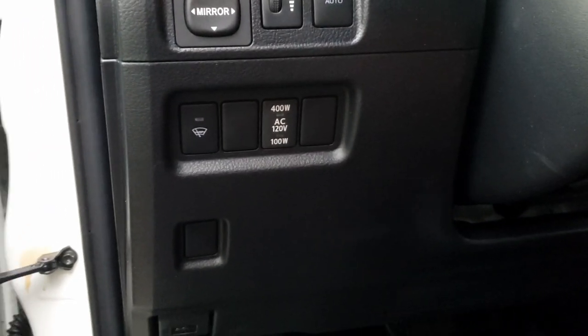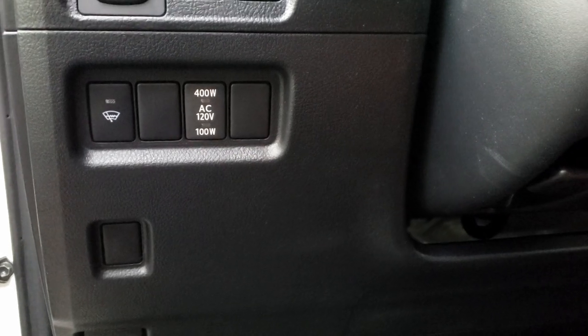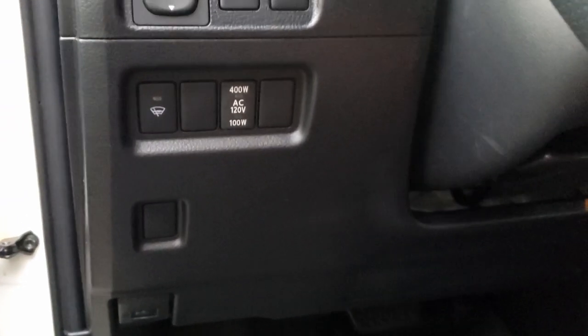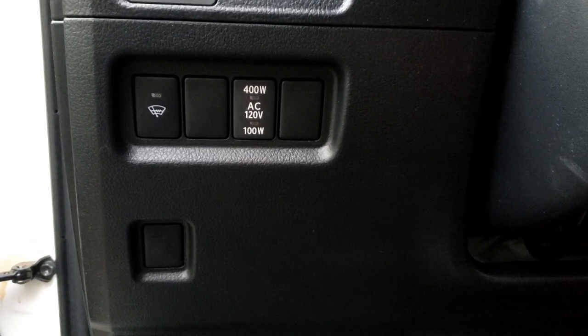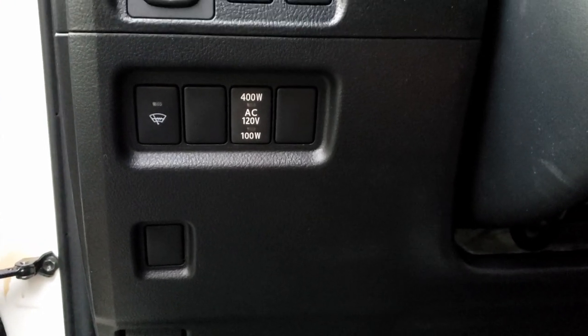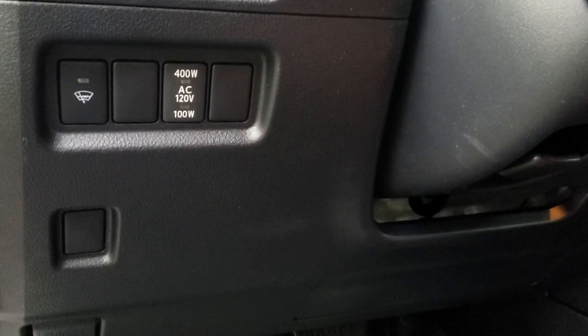Based on the fact that this uses different colors of illumination to tell you what it's doing, you want to be able to see it — some positions are blocked by the steering wheel when you're sitting in the vehicle, which is not ideal. There's another cool spot over here — some 4Runners apparently have a party mode button there. We're going to put it over here, and I think the lower spot is going to be preferable because you can see it if you want to, but it's not staring you in the face, and you can reach it without bending too far. The party mode location is countersunk, making it difficult to grasp the knob, so I think this lower position is going to be the winner.